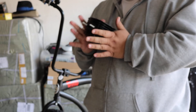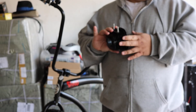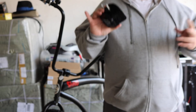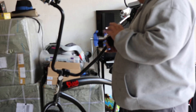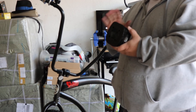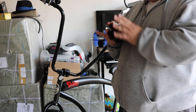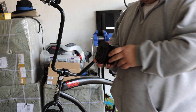Then we'll finish putting the bike together and see how this runs. The average speed on motorized bikes — with a guy my size — runs anywhere from maybe 23 to 25 miles an hour stock out of the box. No matter what bike I put it on, as long as it's 26 inch, it runs about 23 to 25. So we're going to put a little bit of performance parts on here: I'm going to add that intake, change some gaskets, put an NGK plug on, add some upgraded parts. We're going to put a speedometer on and do a test run in another video to actually see if that increases performance. The exhaust I haven't messed with yet, but I'm going to do both and then I will be back.